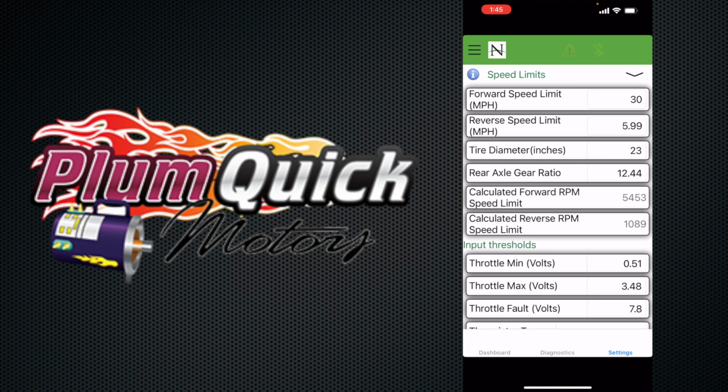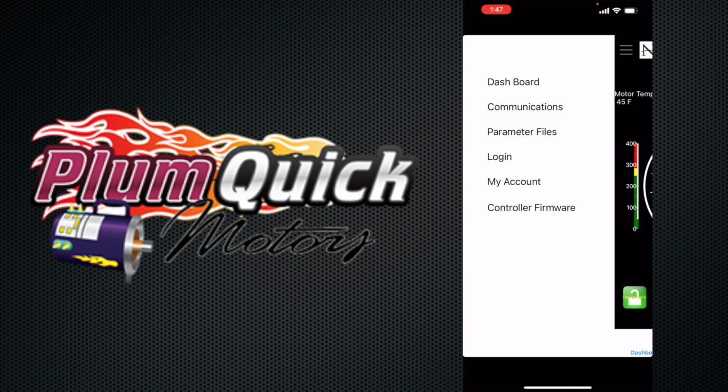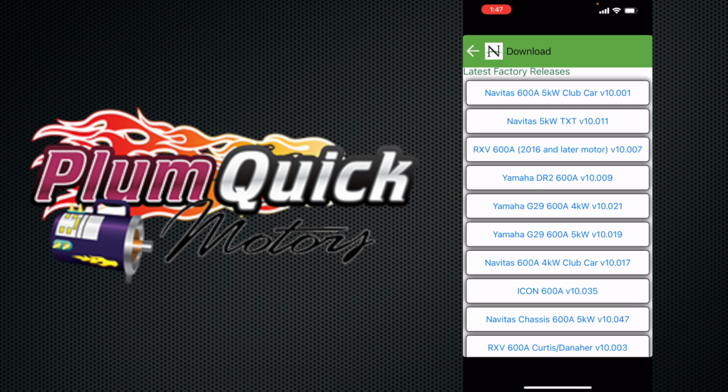Now we're back at the dashboard here. We're gonna click the 3 lines at the top left. We're gonna come in here to controller firmware. Right now, the present software version is 8.021 Yamaha G29 600A 4kW Navitas. We're gonna come down here to the Yamaha G29 600A 4kW version 10.021. We're gonna click that, yes.